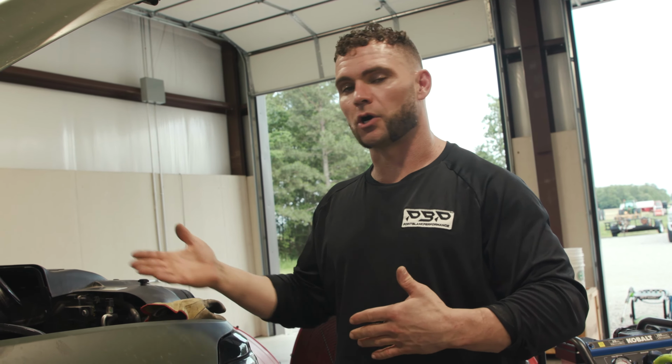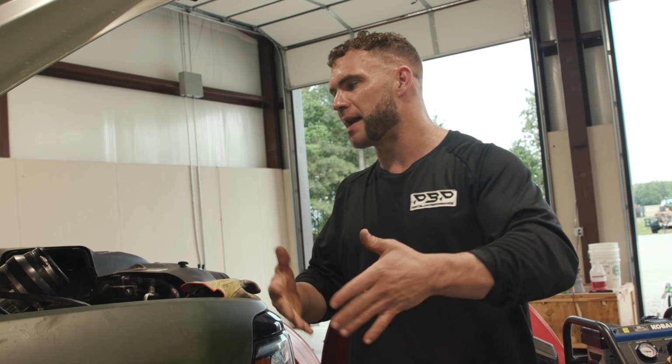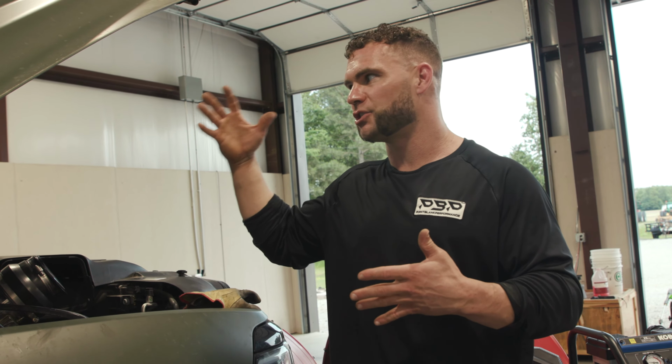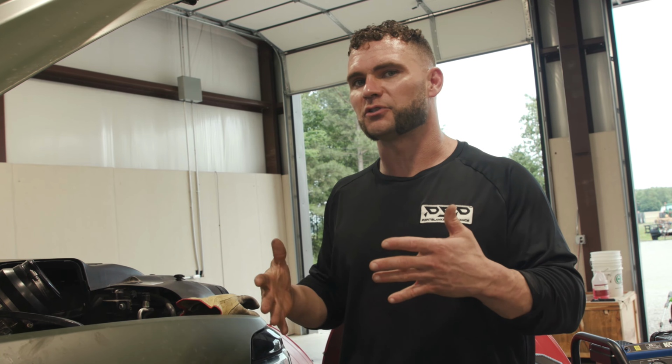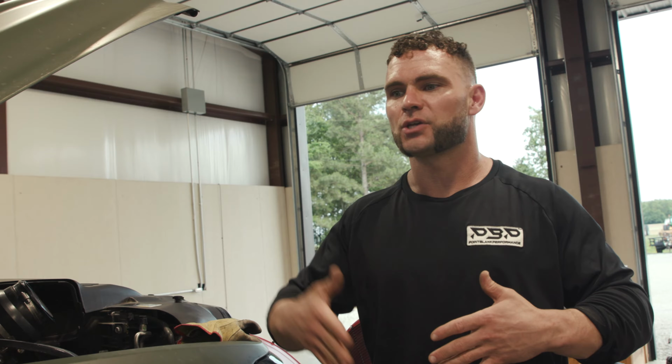What we're gonna do is we're gonna load the dyno a little bit differently. We're gonna try to get that boost pressure to really come in down low, and so therefore it can mix with the fuel and make some power, because we know we've got a shitload of fuel to play with, but there's no sense of adding fuel because we need the air to clean it up. So guys, let's load it differently. Let's make another pull.